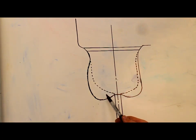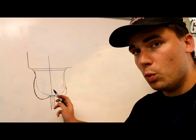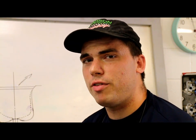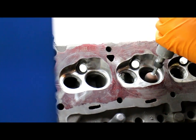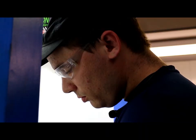We've cut away more on the cylinder wall side because there's a tendency for more air to want to flow on that side of the port. When we get to the exhaust, we apply the same principles as the intake bowl — but you have to be careful not to go as far with it. The exhaust bowl and port is very sensitive to bias, and we can't go too far with the castings we're working with unless we want an expensive new casting.